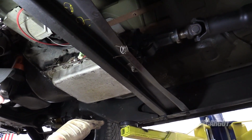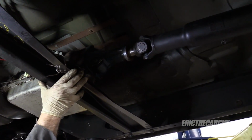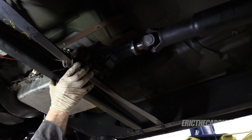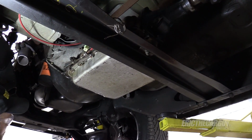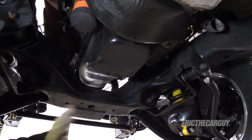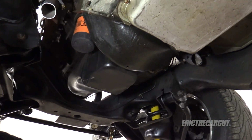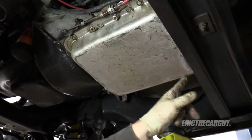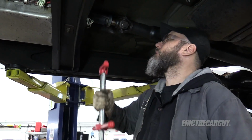And when I'm about to pull the engine, I'll take my floor jack, put it up under here, lift it up high enough to pull this transmission support out, and then I'll drop it down, and that way everything can go out the front, because all we have to worry about clearing is right here. That's it. Everything's going to come forward. Real easy now that we took all this stuff apart. But I'm doing this because there's no access to these fasteners for the back of the transmission.